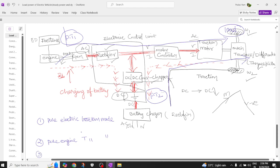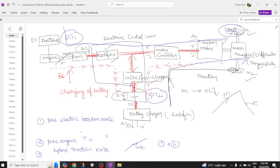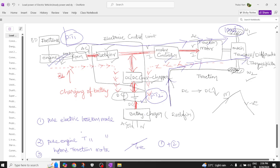The third pattern is hybrid traction mode. When the vehicle needs to travel on a high-gradient road with a positive slope — like climbing a hill — it uses both powertrain one and powertrain two simultaneously. Powertrain one (engine) and powertrain two (battery discharging to motor controller) both supply power to the load, providing the extra current needed.